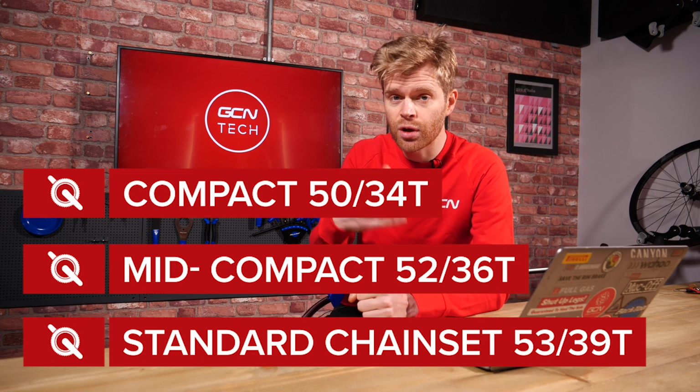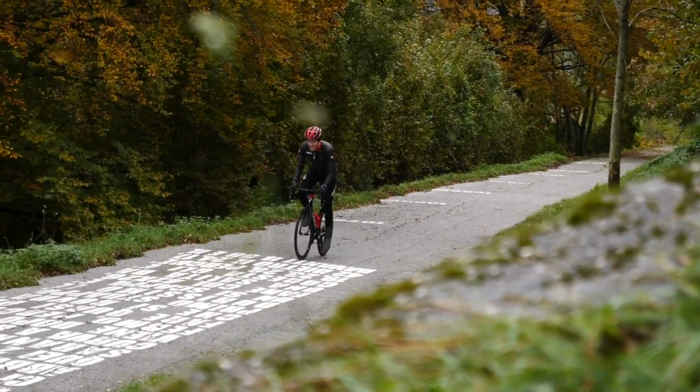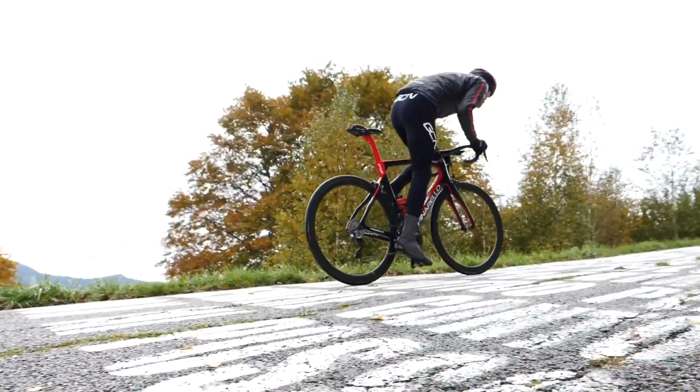But yeah, factor in what you're going to be able to do on the hills. So what I actually like to do is to use a 39/53 most of the time, but then pair that with a bigger cassette on the back. Because more modern derailleurs now accommodate bigger cassettes, you can put an 11-32 on the rear, and therefore you still have that big spread of gears and the easier 32 cog for the hills, and I find that works pretty well most of the time.